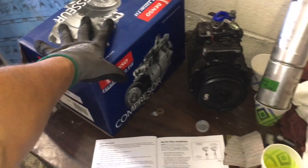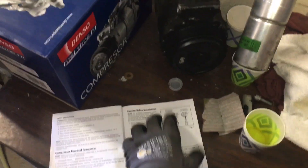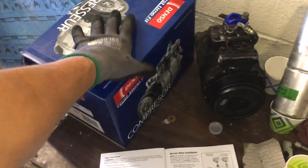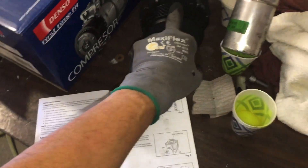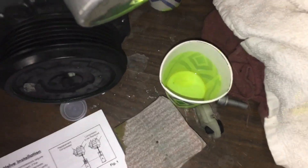The mechanic asked me what to do. I said open the book, look for the picture, read the paragraph, and follow the instructions. He called me back and said he went to dump out the oil from the old compressor and measure it to balance the oil charge, and the new Denso came with no oil. So he followed the instructions to pour out the oil and only a few drops came out — that's it.